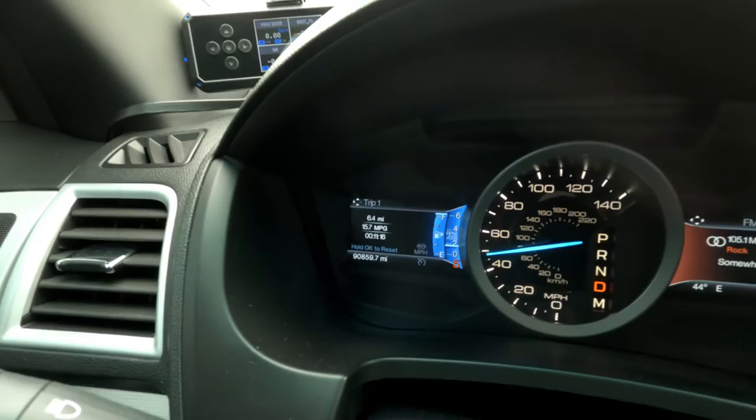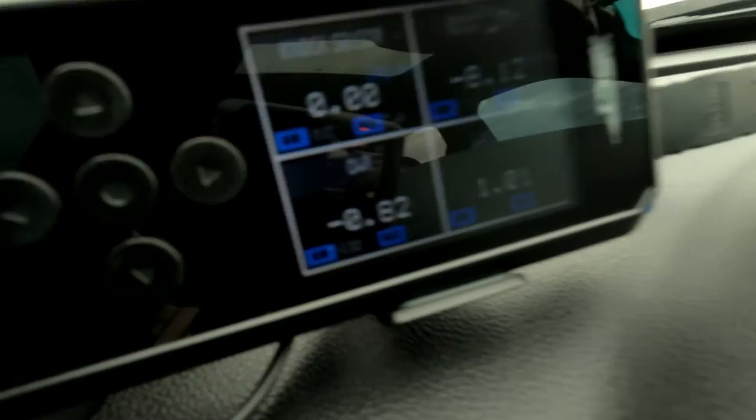I reset my trip and I'm at 6 miles since putting in the ethanol. It's already adjusted — I wish I caught it sooner, but it does happen quickly this way. My octane adjust ratio is already up to 0.82. The higher that number toward 0.96, the more timing and more boost. I'll demonstrate now — I do moderate to heavy throttle to lug the engine. Another parameter I watch is the knock sensors.